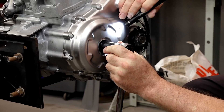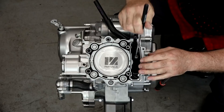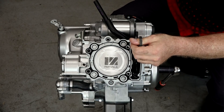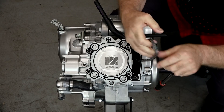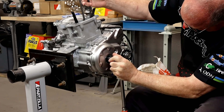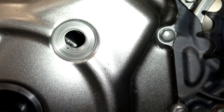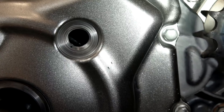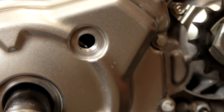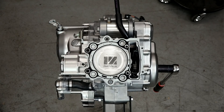As predicted, she's a little bit off — I can't see that eye mark and that's what we're looking for. You don't need this large of a wrench to turn the engine over, but I use one this big just so it will hold it in place via gravity. There it is. We've got our surfaces cleaned up, this is prepped, top dead center — ready to close this thing up.